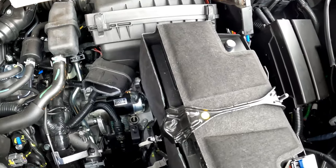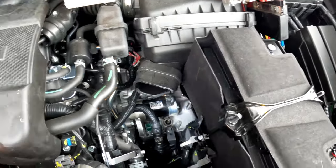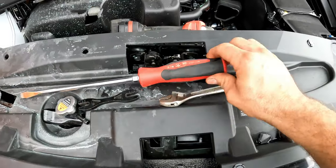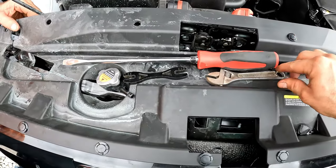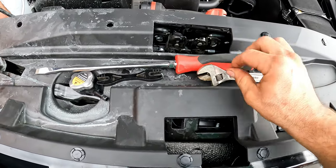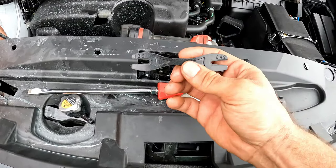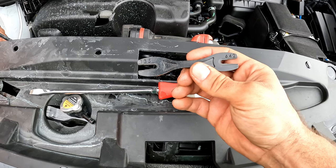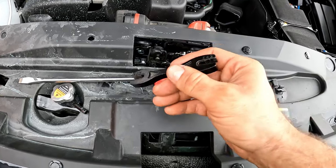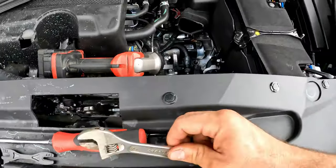In order to get into neutral, we've got a couple of different options. We're going to need a large screwdriver, and in this case a six-inch crescent wrench — or you could also use a small spoke wrench, like for tightening motorcycle spokes. We'll show you both ways.